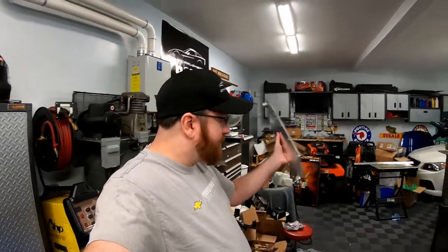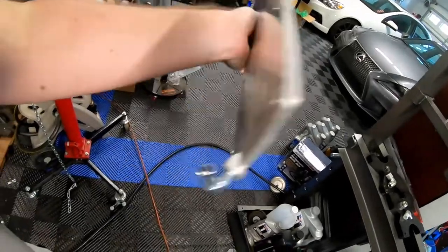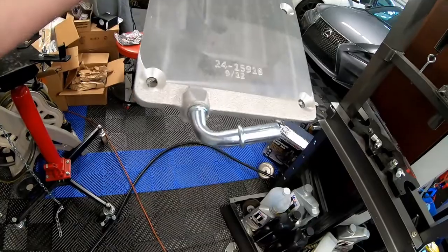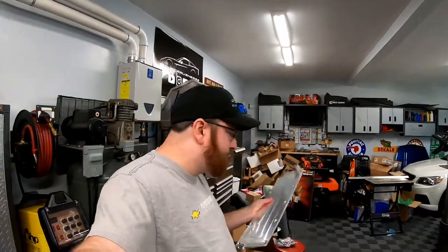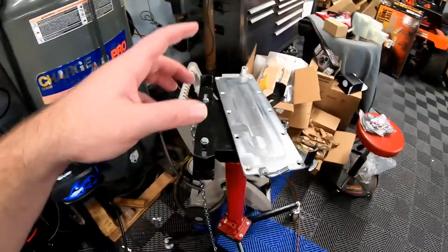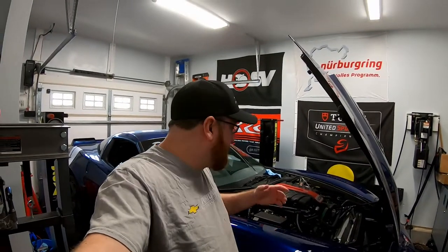So how is this plate going to help our ventilation problem? There's a very small hole drilled right there into the plate, and on the other side is a PCV hose tube assembly. This tube connects to that hole and allows your crankcase ventilation to escape and get routed into your catch cans, check valves, whatever setup you have. This valley cover is actually stock for the LS3 dry sump and LS7 dry sump supercharger kits. I just wish Edelbrock had provided this valley cover plate for everyone.